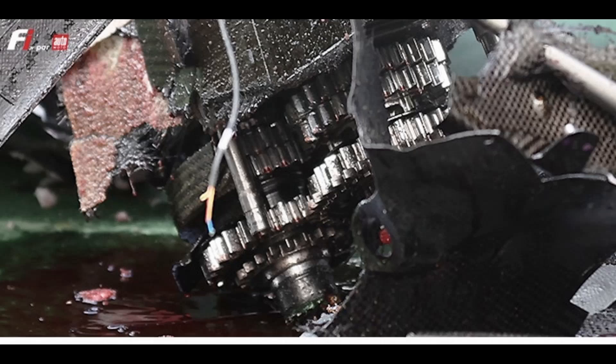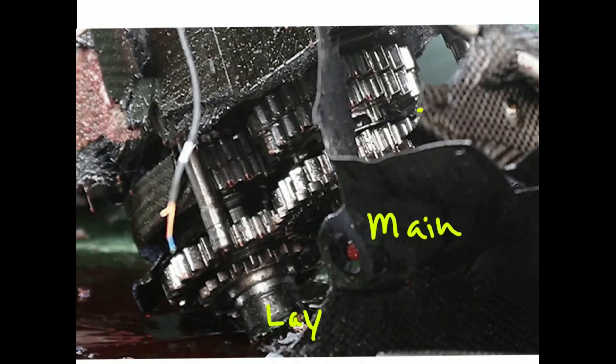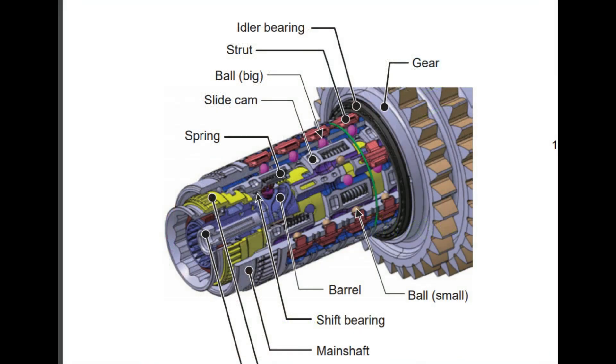So again, you can see quite a bit of interesting stuff right here as well. This is going to be your lay shaft, and this up here will be your main shaft. What's really interesting is you can very clearly see that there is some sort of slider or dog clutch. What's interesting to me is that in 2009, Honda actually had a gearbox designed during the V8 era that was essentially a seamless gearbox like this — it had a clutch or strut mechanism that allowed for gear selection, but the entire gear selection was incorporated inside of the main shaft itself. So there were no sliders, there were no shift barrels. It really eliminated a lot of components from the gearbox.